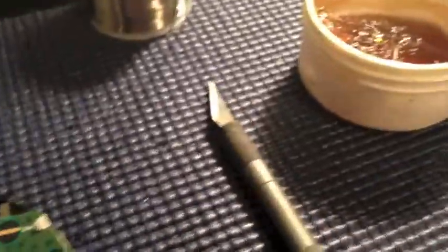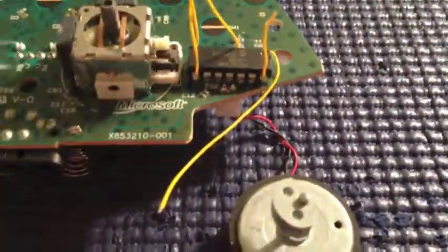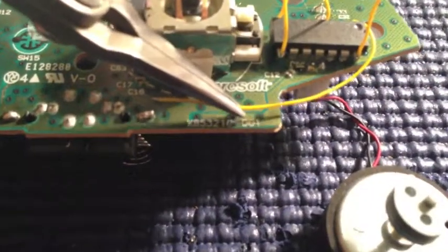So first thing we're going to do is connect power. That is this one right here, and we're going to wrap it around this side. Let me kind of get this set. So I wrap it around like this, and then I come over to here, and it's right here, this power pin. So let me just use the knife and show you. This right here, this is the power. It's the right side for the batteries. As you can see, it comes right up, and that's where we're going to solder power to. So just kind of have it curl around and twirl around, and it's going to land right there. So it'll fit nice, and then we'll just tuck it away, and we'll move on to the next one.